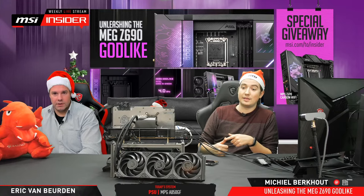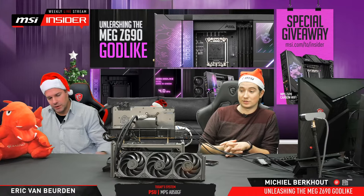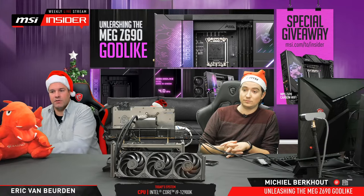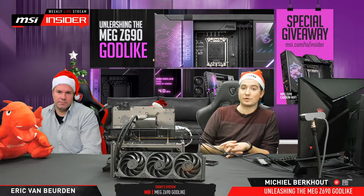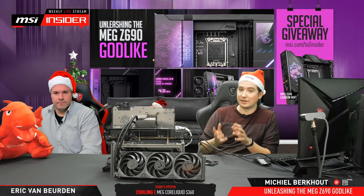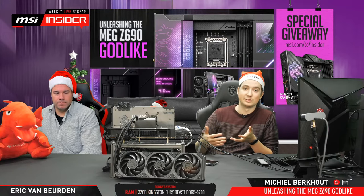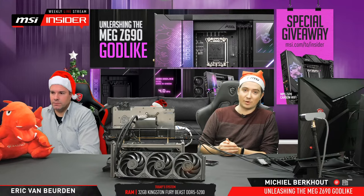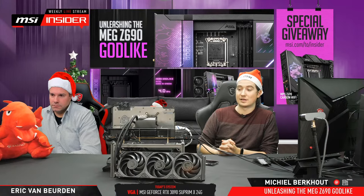Yeah, that was what I was saying. Then we also have Tomahawk and many promos. So entry level is all DDR4, and more the high-end ones, everything above Edge, is at least DDR5. Even in our more entry level we also have DDR5, but it doesn't make a lot of sense. For the top-end MEG models, they're always DDR5 only. We don't have any enthusiast segment MEG models that support DDR4. Indeed, the highest-end model for DDR4 is the MPG Z690 Edge Wi-Fi.